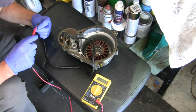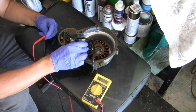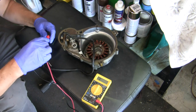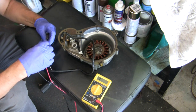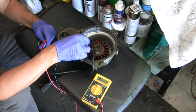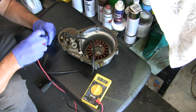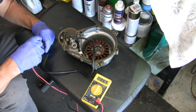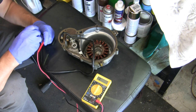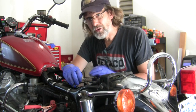Let's go back to our Suzuki stator that I know is in good condition as an example. Each of these three leads I'm going to circuit to ground, and I should get nothing on any of them — and I do not get anything. Nothing. And if I test across these three leads: 1.4, 1.3, 1.4, 1.3, and 1.3. So this is a good stator, and it would appear this one is not.